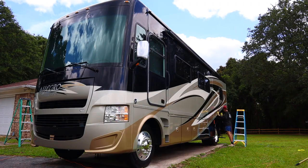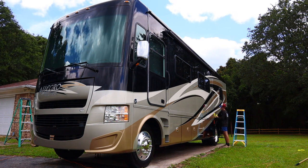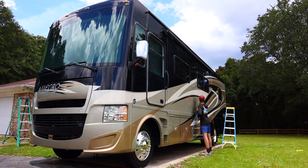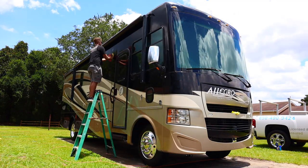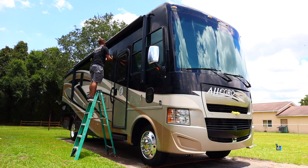It has now been 30 minutes since this side is done, so Dylan here now has two microfiber rags and he's going to take it off. Again, he's going to follow that same pattern, doing the whole bottom side, and then we're going to do the top side. So apply all of your Jescar Power Lock, wait 30 minutes and make sure everything is nice and dry, and take your microfiber rags and remove it.